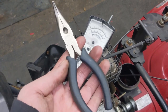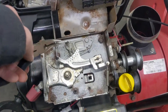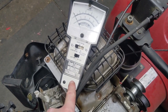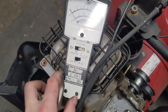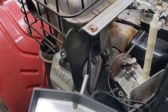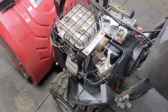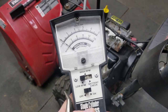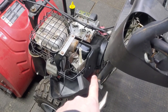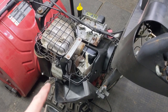When I get this outside I'm going to be filming the adjustment of the RPM. I'm going to be using a set of 45-degree needle nose pliers to make my adjustments for the high RPM as well as the low RPM. To track where my RPM is, I'm using this single cylinder wireless tachometer from Stenz. You just hold this thing on and it goes to the spark plug lead. Essentially whenever the engine's ignition module is producing electrical current, this detects that and tells you how many times that happens per minute — because on the flywheel there's a magnet on the outside, and every time that magnet passes the ignition module, electrical current is supplied to the spark plug.